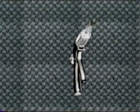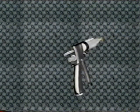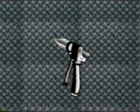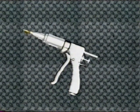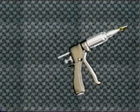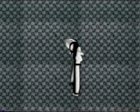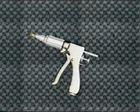This is where the Phoenix injector excels. Because the Phoenix injector can provide both positive and negative pressures, it is a pressure and vacuum bleeder, while at the same time allowing the technician to take advantage of the RFI process on many brake systems. All this in one easy-to-use tool.